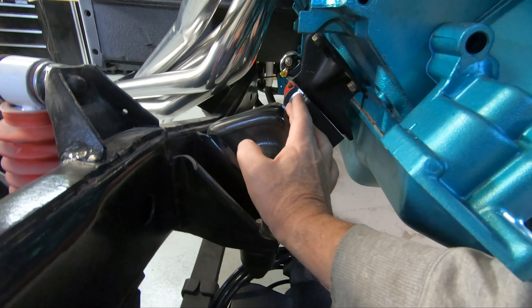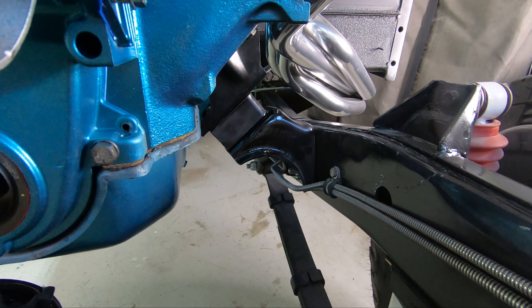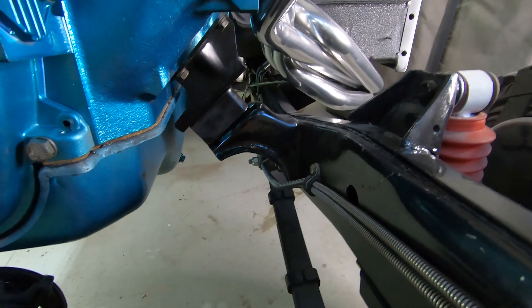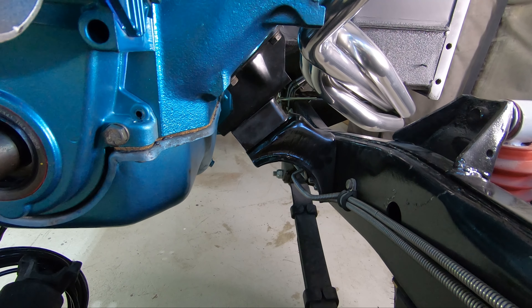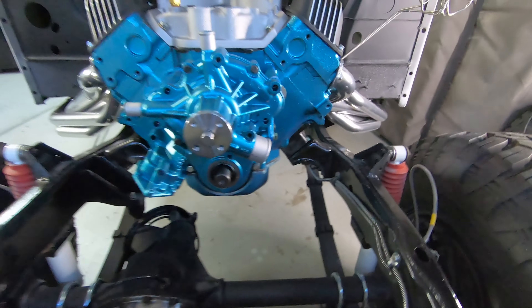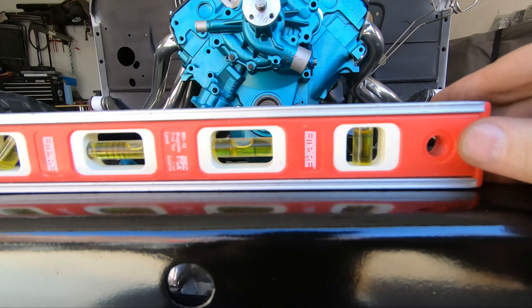I need to go that way - again, not much room to adjust. There is room to adjust on this side; it looks like I can pull this bushing up in this body mount a little bit. This side, however, looks like it just wants to sit there. So these are the original body mounts or engine mounts for this thing. I found the old bushing and tried to make sure that my bolts all lined up and that I wasn't putting them in wrong - there's only one way they'll go. So it's not that my bushing is incorrect; perhaps it's that my bushing is a little bit thicker than the original, so maybe the thing's not sitting down in deep enough. That's my conundrum today - to mess around with this a little bit and just see if I can fine-tune this alignment.